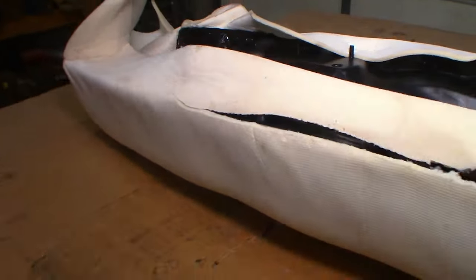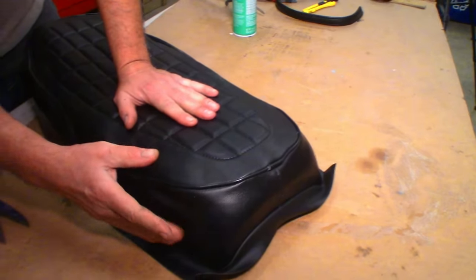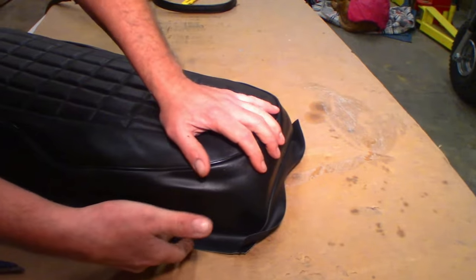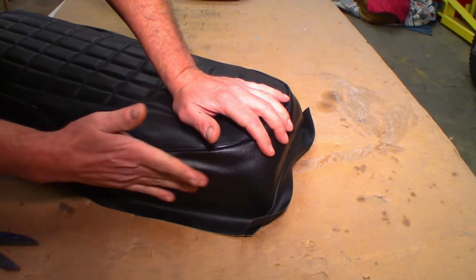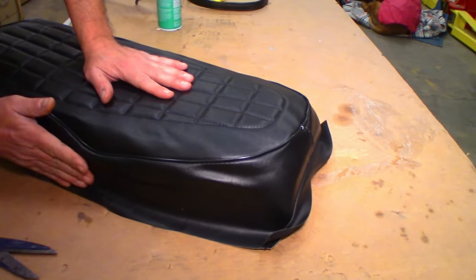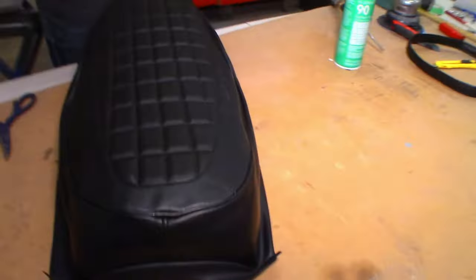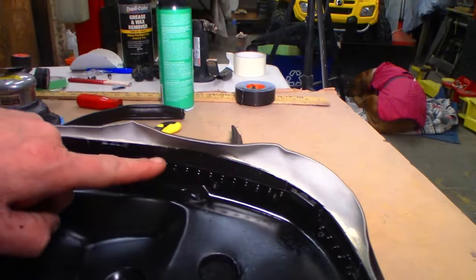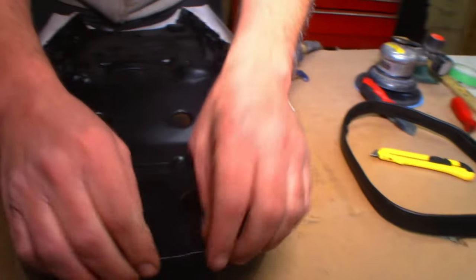The good thing about that flex foam, it still has enough give to it. If you have a high spot, we'll just stretch that chunk on the carpet strips one way or the other a little bit to smooth the high spots out. And we'll be a little bit looser on the low spots, and you're not gonna see one wrinkle in this darn thing. And that's the nice thing about having one tiny little spike all the way around. We can put it on, and if there's a wrinkle here, we can pull it back off really easy and move it one way or the other.